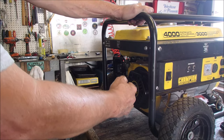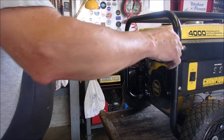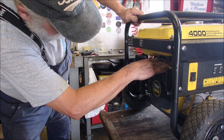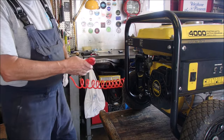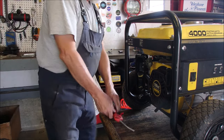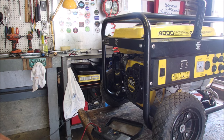Okay, let's just do a choke, and start it up and see if anything's different. I do have my spark indicator on there. We'll disconnect it after, because it might have a weak coil too, right? I'll come back in a bit, guys. I'm just checking to see if I'm getting a bad reading out of the oil shutdown or the high volt shutdown leads.